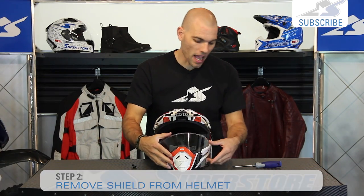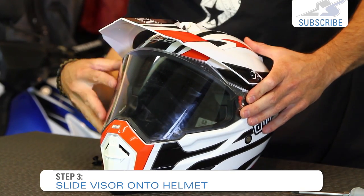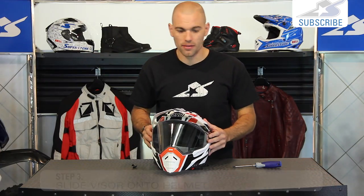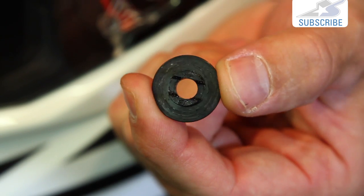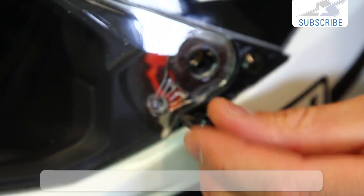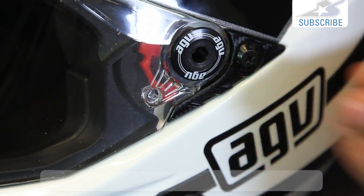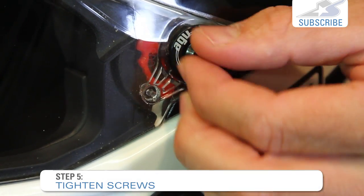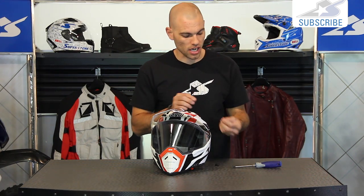As this shield goes back into place, there are really no retainer pins or anything. You simply slide it in, guide it over one small round area. Here's where it gets somewhat tricky — and by that it's really not. This washer has a small set of dog gears on it; those have to slip into certain guides right here. But once you get these lined up, you just put your screw back in and you're back in business. Extremely straightforward — just that one little catch with the screw. Once you check it out one time, you can do this in a matter of probably 10 seconds.